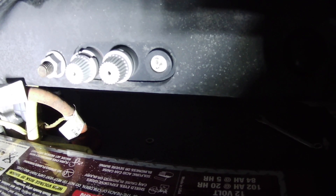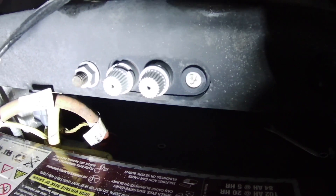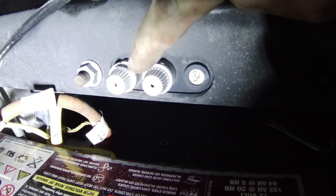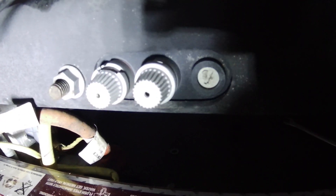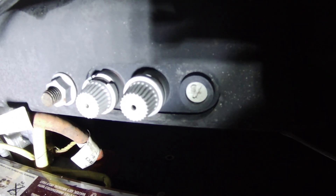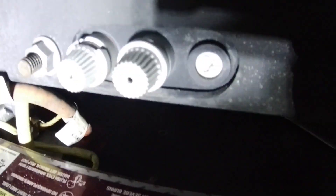You'll see your three fuses and your master switch. On Gen 1, they'll be hidden in a little corner when you pull up the seat and the batteries are in there. You can see right here this third little spot is actually stripped out, and that's very common. It's also common for these not to be flushed or for the fuse holders themselves to break. So it's really important to open these up, check the fuses themselves, and also check behind to make sure the fuse holders are good. Come back to this after the next diagnostic steps, because if you're not getting power to the cluster or your DC-DC converter, these fuses are probably the culprit.